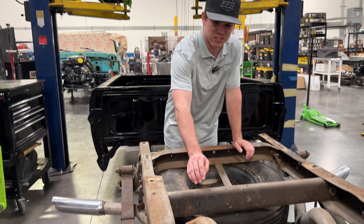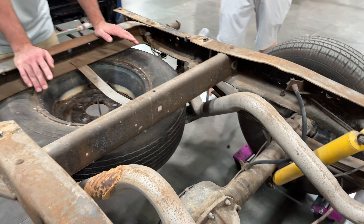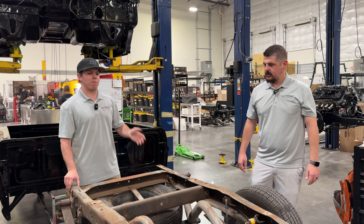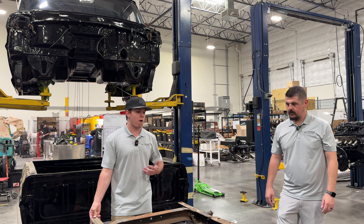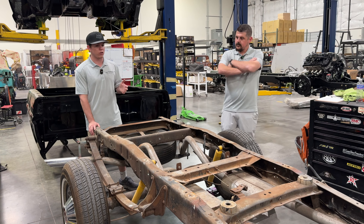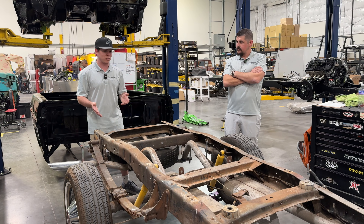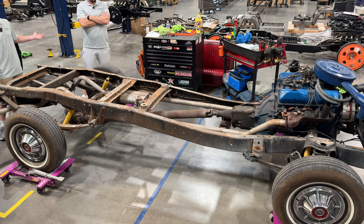Cool to look at the technology of the old exhaust system running back here — you can see the little exhaust hangers and your mufflers. Old cab mounts are in here too. Back in the 70s, you were pimping if you had Ford's twin I-beam suspension when they came out with it in the late 60s — that was the coolest thing on the line at the time. Since then it's been replaced and replaced and re-replaced. Not saying there's anything particularly wrong with it — it just improved. Things improved over time, technology got better, the world switched to more of a fuel injection, more modern drivetrain style. Twin I-beam is great, it serves its purpose, same with the rear leaf spring. But if you're wanting to do a high horsepower, nice daily driver build, this is not your answer. If any of you have owned these trucks and tried to drive them daily, you'll understand — the brakes are shot, the steering doesn't work, and it rides like you're off-roading at all times.